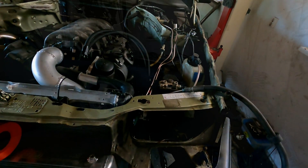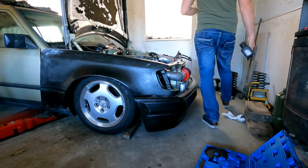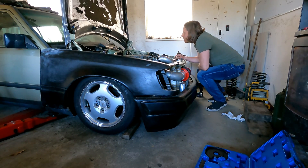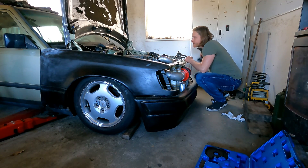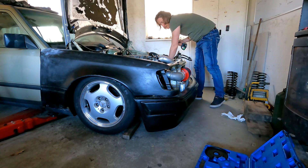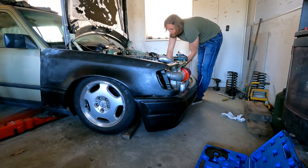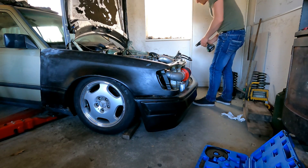I've put the fender on — it's not tight — but the system is all bled out, so the air is out as much as possible. I can just turn the pump with a normal drill bit and it will pump oil into the system just like it should. I also want to mention that the springs are not in there because they are too strong — I already tried and they keep the car too far up. I have to cut a little bit into the spring, but first I want to show you how this works.